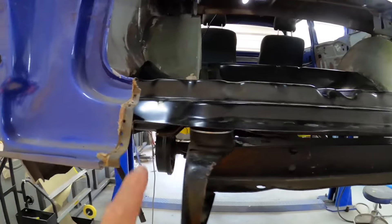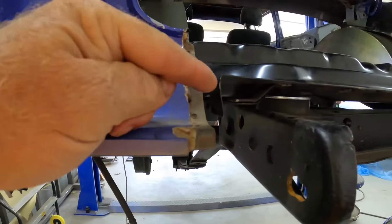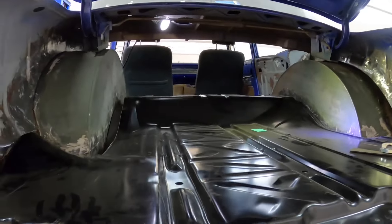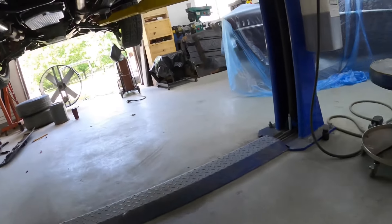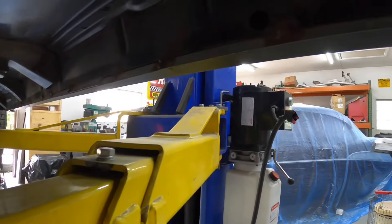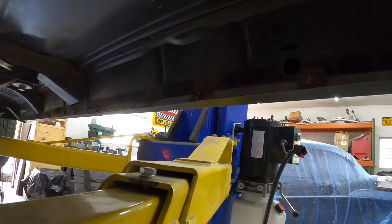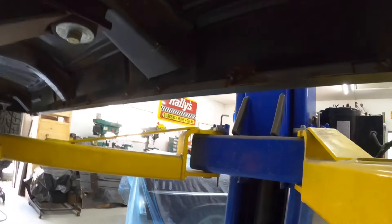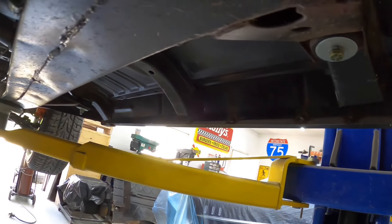See the difference between here and here? I'm 100% sure that's supposed to be damn close to that. This side is a bit closer. What's going on is when they put the new floor in, the actual floor pan of the car - you see those welds there? See how those two seams are supposed to line up, and they're not - it's up that half inch. The back of the car is welded up higher than the front. The other side here is different again - they welded it all over the place, and the floor pan is welded higher than the bottom of the rocker. So it needs to be taken off and repaired.